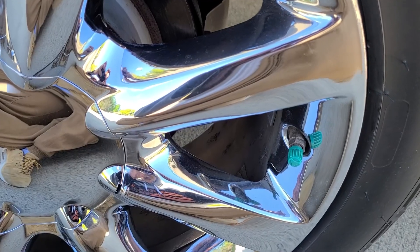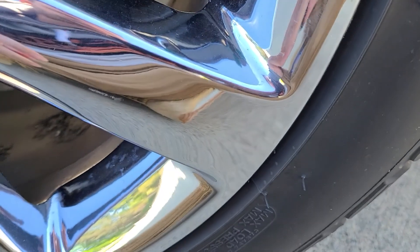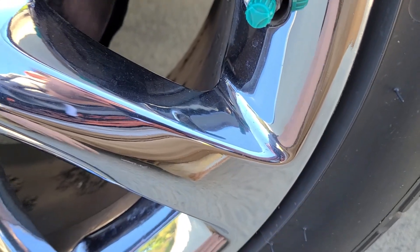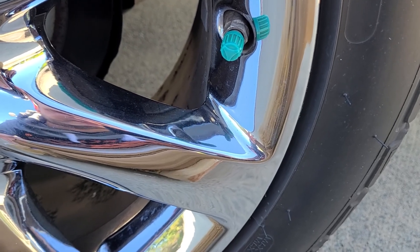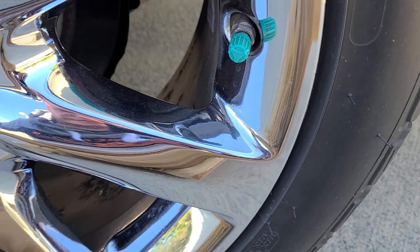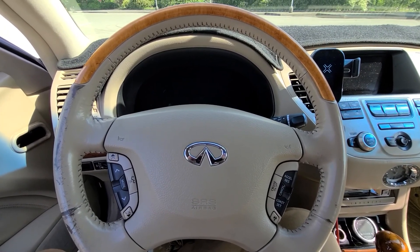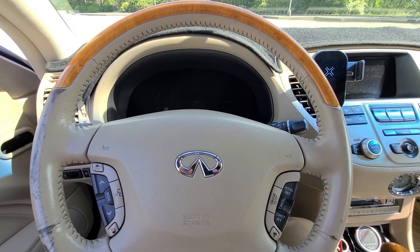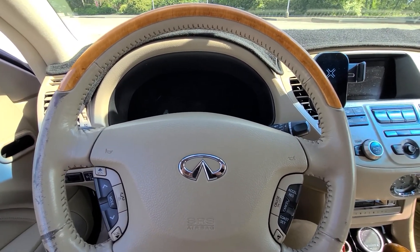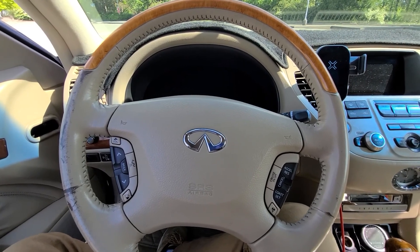I'll have a whole video on that, of course. I also have to take these wheels off and get them refinished, because there's a fair bit of oxidization, and even the slightest amount of pitting on the bead will create a small leak. Both my rears leak pretty bad — takes about three days to go from 30 psi down to about 22, right where the sensor goes off. Once the wheels are done, the valve covers and power steering are all fixed, I'm just going to drive this car and enjoy it, take it on road trips until the next stage. The next stage comes when I refresh the motor and swap in VH45 pistons and rods.